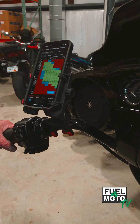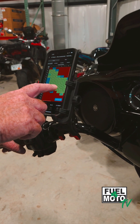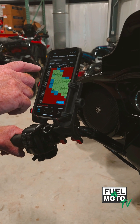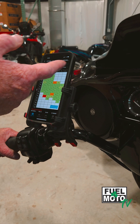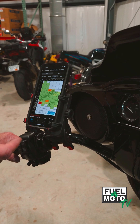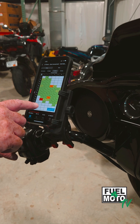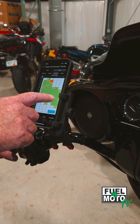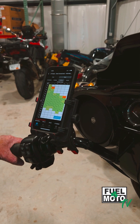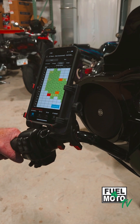Once you've completed your AutoTune run, you can analyze your session. This is from about a 15-minute ride through the industrial park. On the histogram screen you can see the area where it's generated its corrections and data. You can go through various screens: hit count, average, and percent error. The percent error is what AutoTune has derived from the O2 sensors versus the commanded AFR table or lambda. Most of this is right on the money — a couple outliers were a couple percent off. The rear is actually even closer. For the most part, the tune we were using here was really, really accurate.